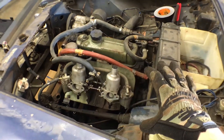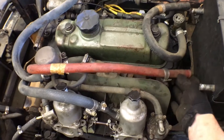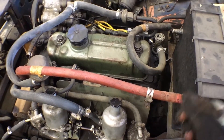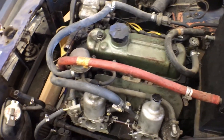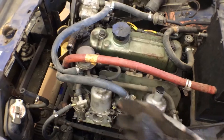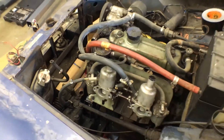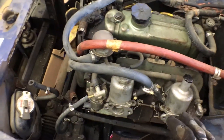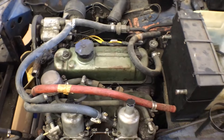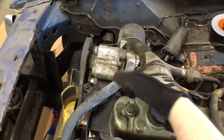The nice thing about doing an EV conversion is I don't have to be careful with this stuff. I disconnected these, but if they were going to give me a hassle, I could just cut them off or hit them with a utility knife or something. I don't need to salvage any of these things. I'm not taking it out to put yet another internal combustion engine back in. If something in here doesn't help this car move forward under electric power, it's coming out — things like air pumps and so on.